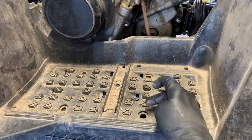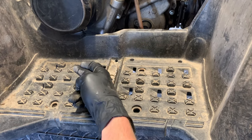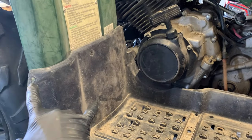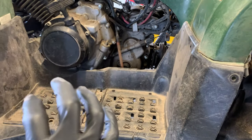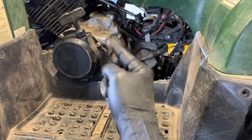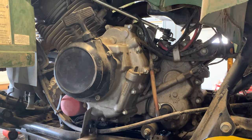That's what the footwell looks like — you can see we've got four of those 10mm bolts, three of the allens in the front, and then three in the back. So for the charging system, we're going to be dealing with the recoil as well as the engine crankcase cover on this side. Pulling this footwell off is easy at this point — you've got all those bolts out and you just lift that straight off.